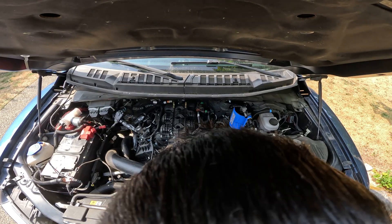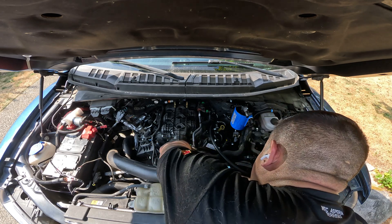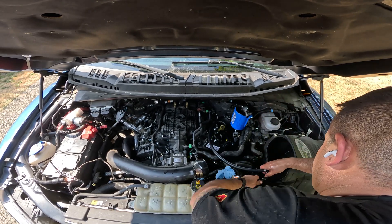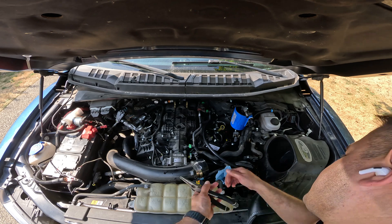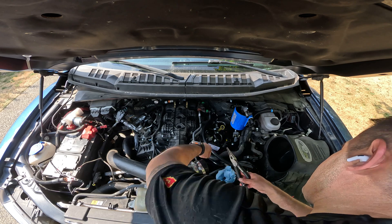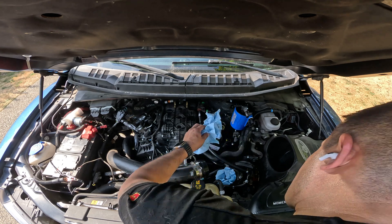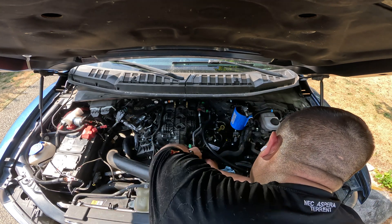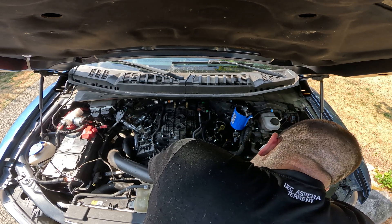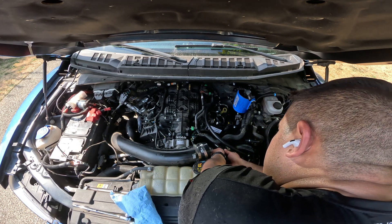The coolant fountain was not shown in the IAG video or the paper instructions, so I didn't expect it or have the turbo inlets covered. I found that you need to use both hands to remove one hose while immediately installing the AOS hose. This can all be avoided by verifying that the clamp is oriented properly towards you before swapping out the hoses, so that the new hose going on the barb has the clamp pointed towards you.